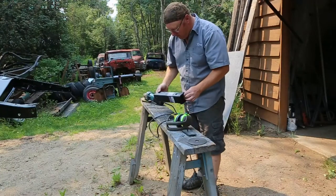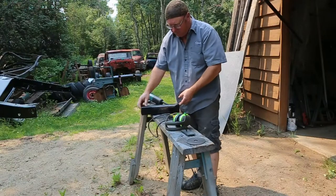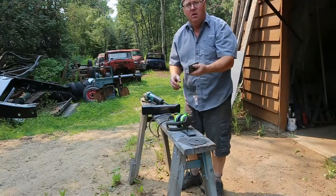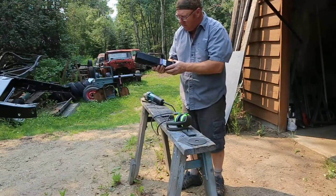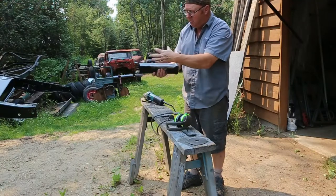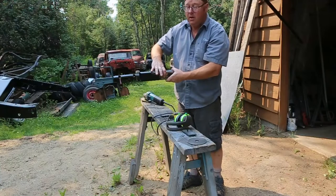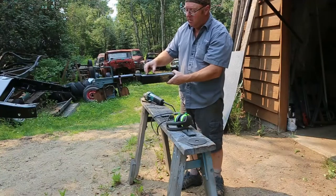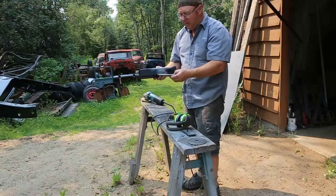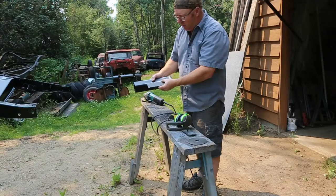Working on the receiver part of everything here now. It's so nice to be able to work outside today. Now here's my thinking. I cut a couple pieces — this is just two-by-a-quarter. This is going to go underneath the bumper. The four-inch back bumper is going to go on top. Then what we're going to do is U-bolt this to that. My piece going across — my two-inch — I'm going to weld that onto here. I've got these six and a half inches long. I'm just going to weld them on there like that, and that'll give us something to bolt up to with the U-bolts.